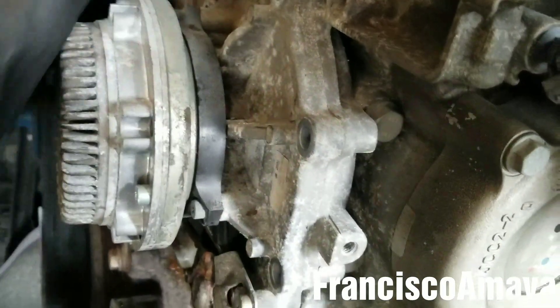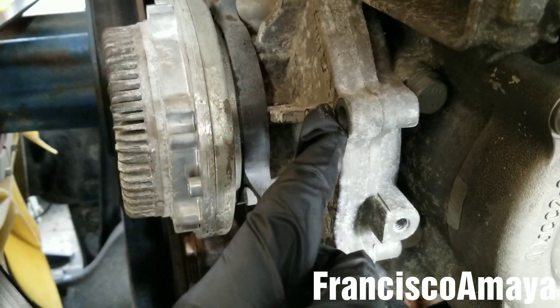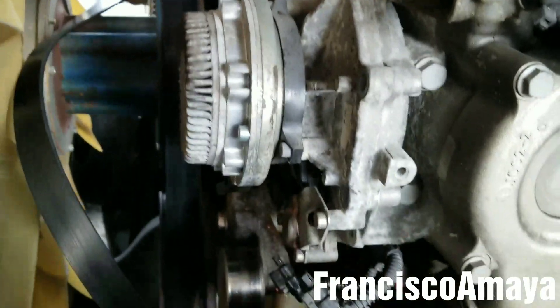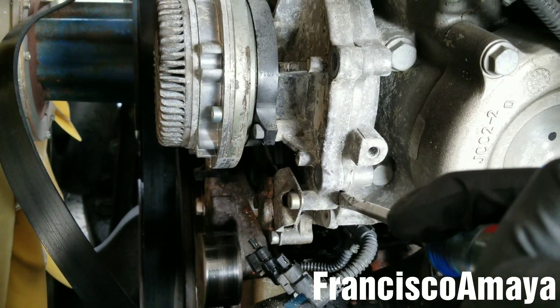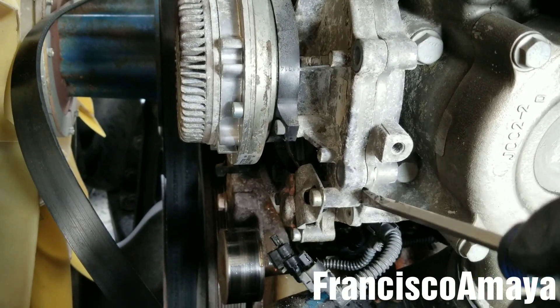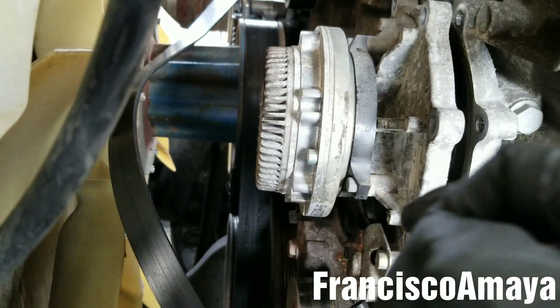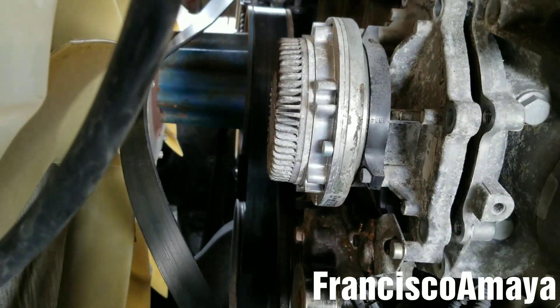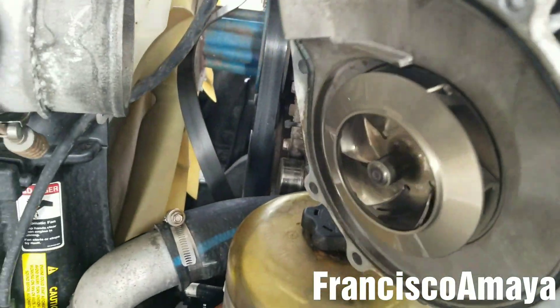All the bolts are completely removed. Make sure to count nine and double-check that there is nothing around the pump, because this water pump is aluminum and you can break it easily. Also, you have to return this water pump as a core when you go buy a new one at the dealer. I'm going to be releasing the water pump seal by inserting a flat screwdriver over here and pulling it until it comes out. There's still a little water coming out, so I'm going to wait a bit. Now I press it until it breaks the seal — and it is out.